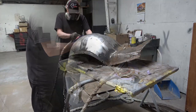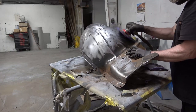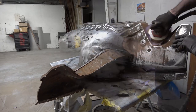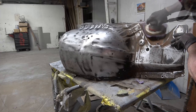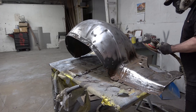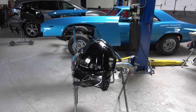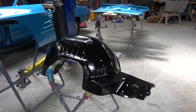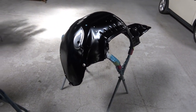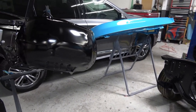They're pitted in some of the really bad rusted areas, but a lot of that is not that noticeable when you open the hood. The main body of the fender well was still in really nice shape — it's only down low in the hidden areas where the rust was really bad. I got most of that off and coated it with rust inhibitors. Here they are all finished — primed, rust-treated, and painted with the correct 30 semi-gloss black that the factory used. They turned out really nice, and now I can start getting the front end of the car back together again.